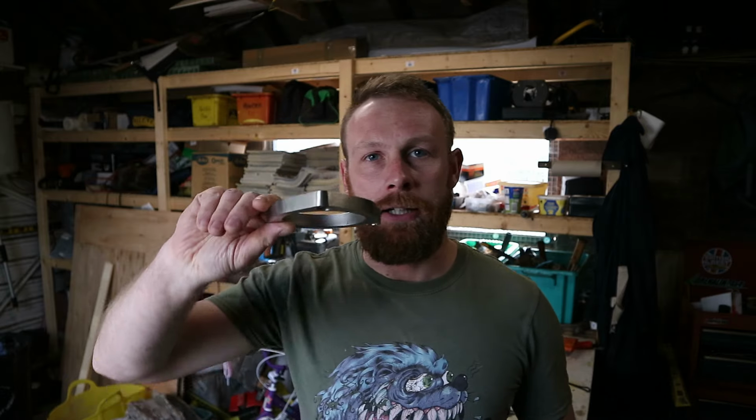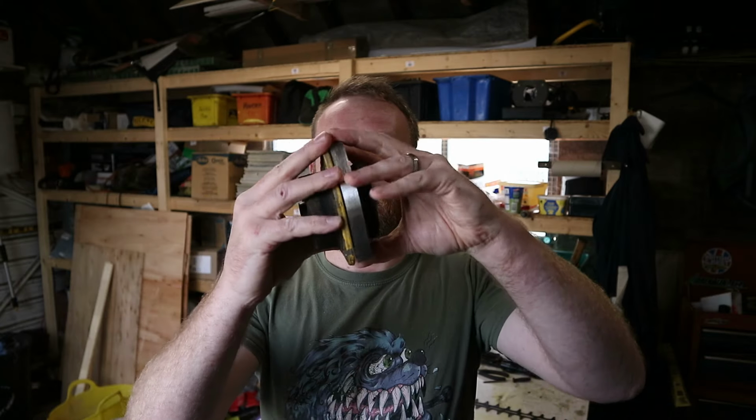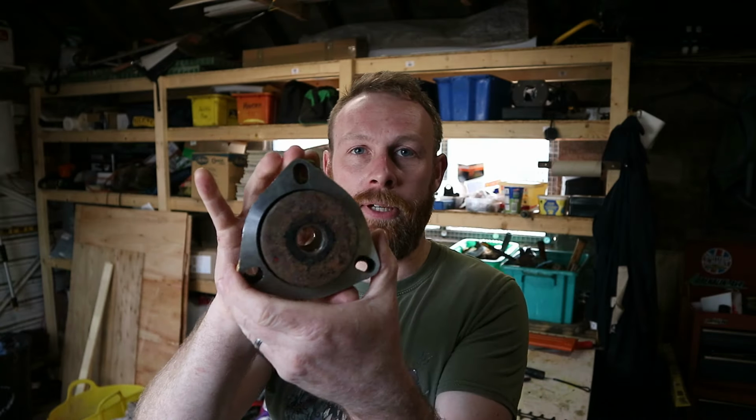Now, one of my subscribers, Christopher from Arizona, made me aware of some spacers that you can fit on the rear radius arms, which push the axle backwards, and hopefully, as it's being pushed backwards, it should pull the nose of the rear diff down and make the angles a lot better within the specifications to stop that droning noise. So I did a bit of research online and found a company that's not that far away from me that make these. These are actually exhaust flanges, but they are 12mm thick stainless steel, and when you tie them into the bushes, they fit perfect. And the holes line up and everything.